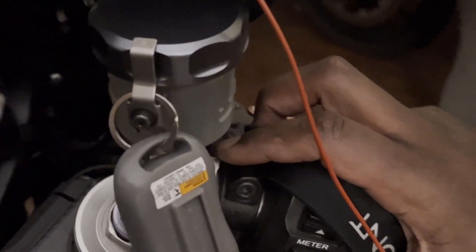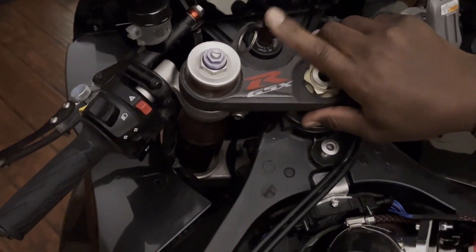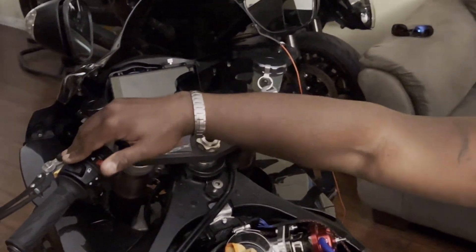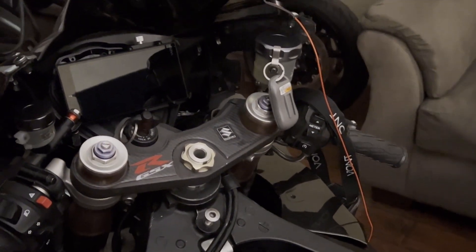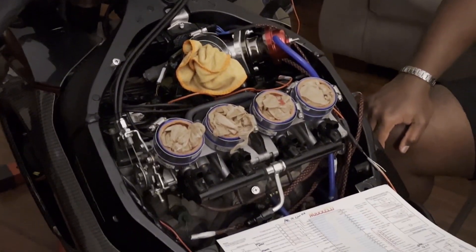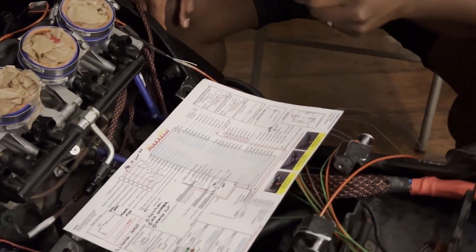I thought: if you have a really expensive standalone system, why only use it for the racetrack? Use it for the street. It's capable of handling all of the complexity of a brand new BMW. So I can still start it, I can still power up the ECU with the stock key. Part of studying was figuring out what wires from these stock parts need to be input into the ECU block through the harness so that I could continue to use the starter button, my horn for air shifting, my turn signals, brake lights, high beam, low beam — all those street-friendly features. I think I've been able to figure out how to continue using those OEM parts with aftermarket standalone technology. I think I've been able to combine the two.